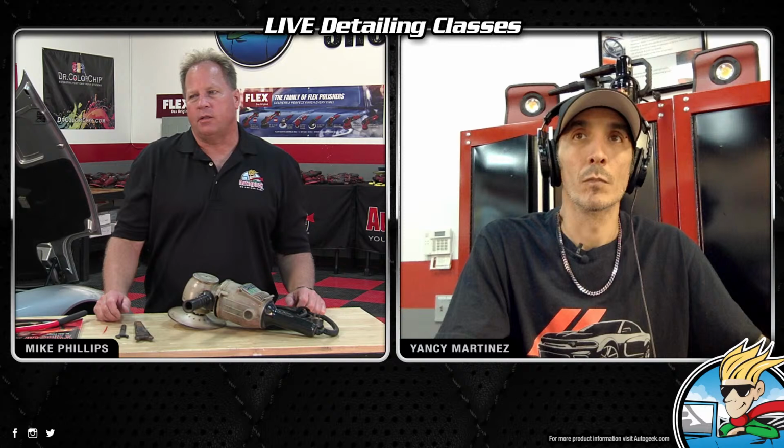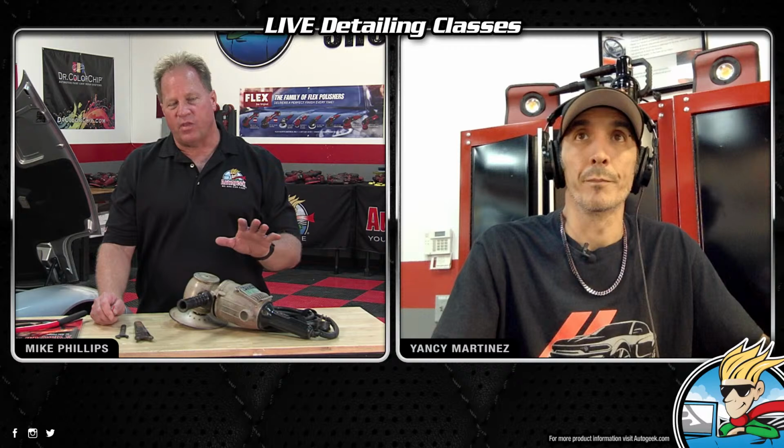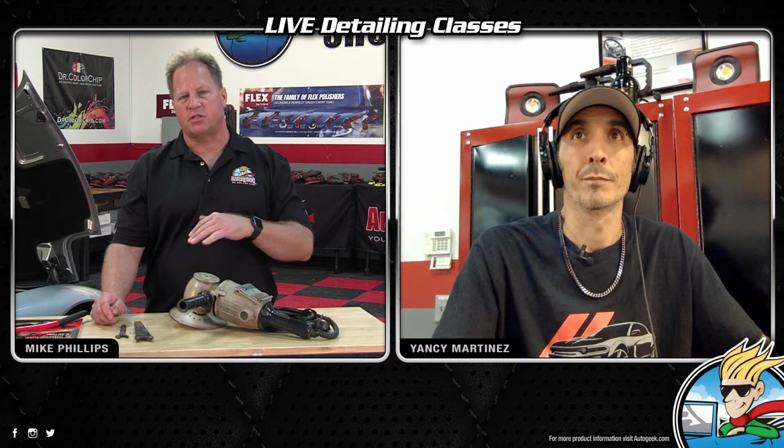If it was me, I always recommend people start out with a short stroke, free spinning random orbital polisher like a Porter Cable or a Griot's G9. And then from there, jump up to a gear driven like a Rupes or any of the tools in the Flex family, called the Beast, the Super Beast, the Sea Beast, and there are other tools out there like that.